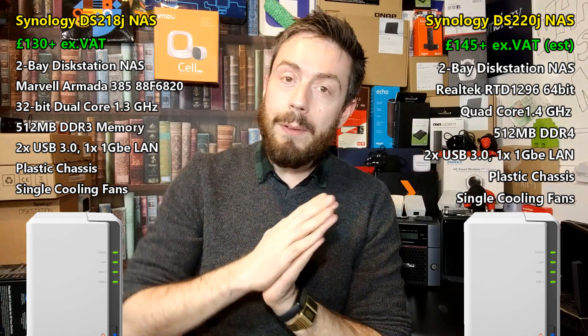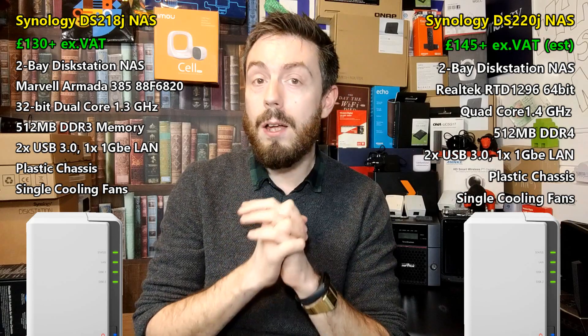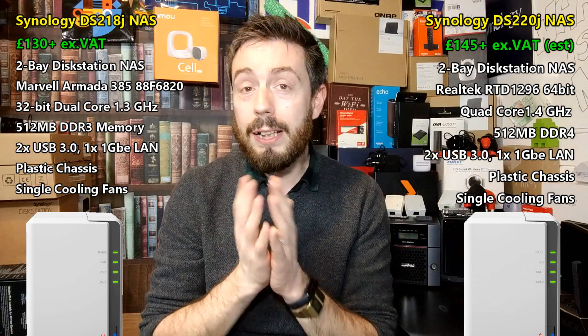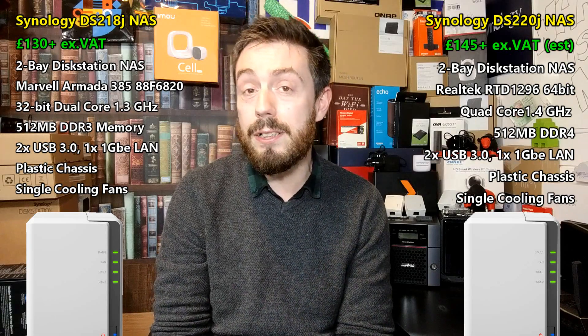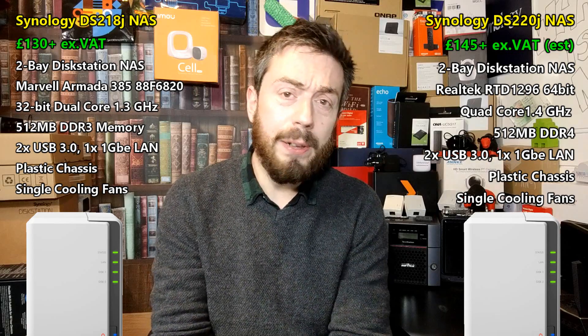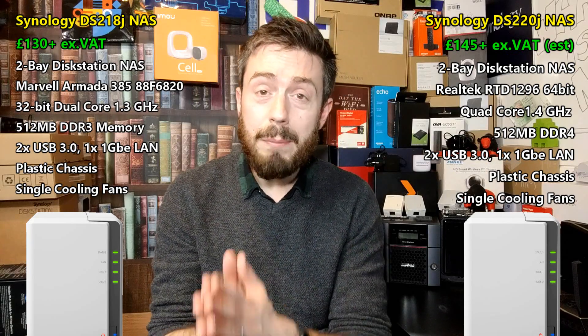To have that CPU and all of its abilities — better efficiency and the ARM 64-bit processor doing a much better job of refining instructions — memory will always be incredibly important in any technological appliance, and NASes are no exception. Not having more than 512MB of non-upgradable memory is not great. Even though you've got a CPU that can technically transcode 4K, it's not going to be able to do that with half a gig of memory. And although this CPU supports BTRFS and has been shown to support 15 to 20 cameras, the official specs don't go higher than 12.